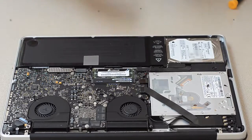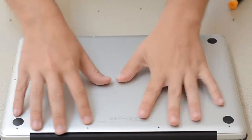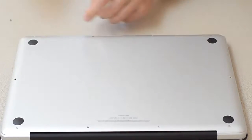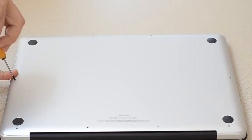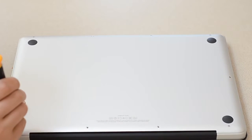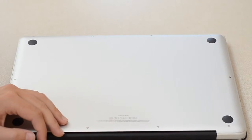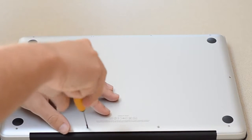Now that that is done, everything looks normal. You put back on the piece of aluminum — just like that it should fit just like it did before — and you screw it back up. Quick tip: try to use a magnetic screwdriver. You'll notice the screws are metal and the MacBook is not, so it's not an issue. It makes screwing things in a hell of a lot easier. These long ones you can just stick them in before you screw them down because the threads are at the bottom. Make sure they're nice and tight but don't do it too hard so you don't strip them for future upgrades. Try not to hit your screwdriver on the Mac and ruin its nice aluminum finish.